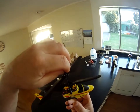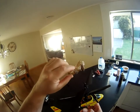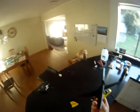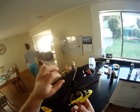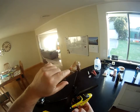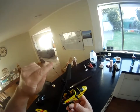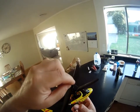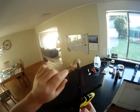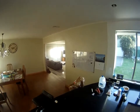So it's got a little bit of end float now. One thing that I did find, and I researched, is the reason it's doing the wash bowl effect: this here was binding. It was still moving — I could still move it — but as you can see, it's really free now. What it was, was this ball joint, top and bottom. I had to sand a bit off, to take the ball joint off, and sand the actual ball on both those components, and then I silicon sprayed it, and now it's very, very free — so I can blow it and it's actually responding.